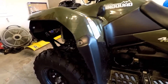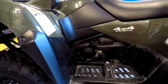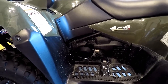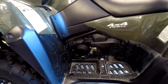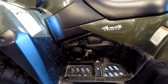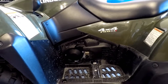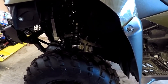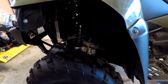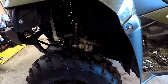Overall, I've had no issues with this since I got it. Starts every time, runs great. There was a recall for these for the charging system — apparently the stator, which is basically an alternator on ATVs and motorcycles, did not put out enough voltage to properly charge the battery. People would be out riding, it would shut off, and they wouldn't be able to start it. That was a recall issued around January or February of this year for the 2016 model. Mine was already taken care of before I bought it.